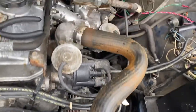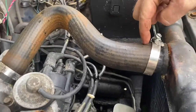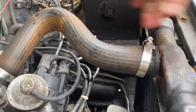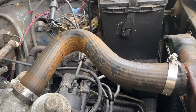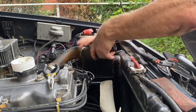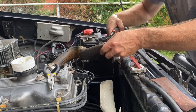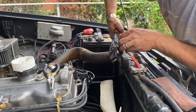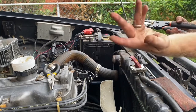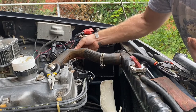Before I tighten this hose clamp back down, I just saw something I don't like. See how this bend is really tight and it actually squeezes the hose? Well, that's because this hose is too long. So I'm going to take probably about an inch off the end of this, move it over, and spread this hose back out the way it's supposed to be — that way it won't collapse on us. I'm going to cut right above where the hose clamp was. Just nip the tip. Slide this back off, and magically, that's back in the shape it's supposed to be.